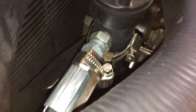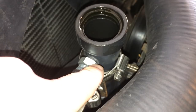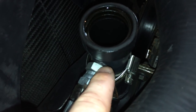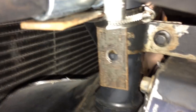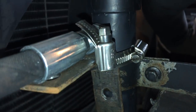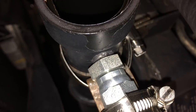I want to show a little more detail about the return line. We put the hydraulic hose to an eighth inch MPT fitting into the plastic fill tube on the engine — we drilled a hole and tapped it to eighth inch MPT and the return line goes in there. There's no nut on it because I don't want to risk a nut falling into the timing cover and getting caught in the gears. As a preventative measure since the tube is only plastic, we put a small L bracket from the tube to the hose, with a hose clamp around the tube and bracket, and another hose clamp around the bracket and hydraulic line — so it will never move. We also put a coat of RTV around those threads to prevent any leaks.